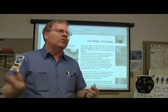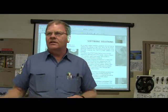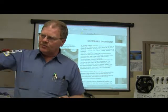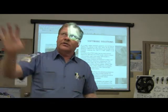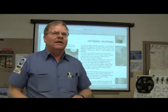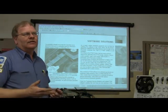And if that don't fix it, we'll go into the transmission and figure out what's wrong with it. So they brought it over there, and I pulled it into my stall, and I hooked the DRB3 up to it, which is a big scan tool, and use it for a bridge between the computer that's hooked to Chrysler, and the computer hooked to Chrysler identified that vehicle and said there is a reflash available for this thing, for the transmission control module.